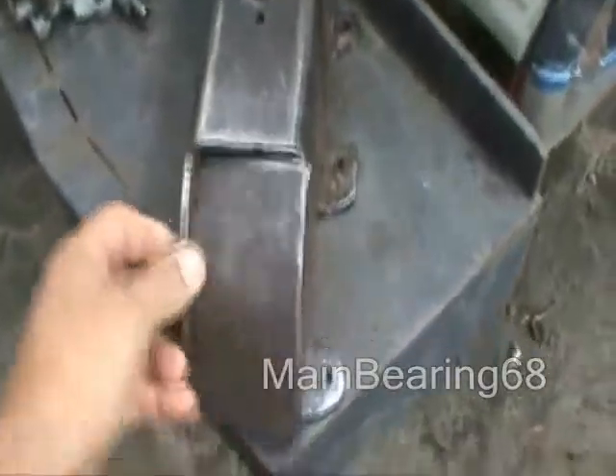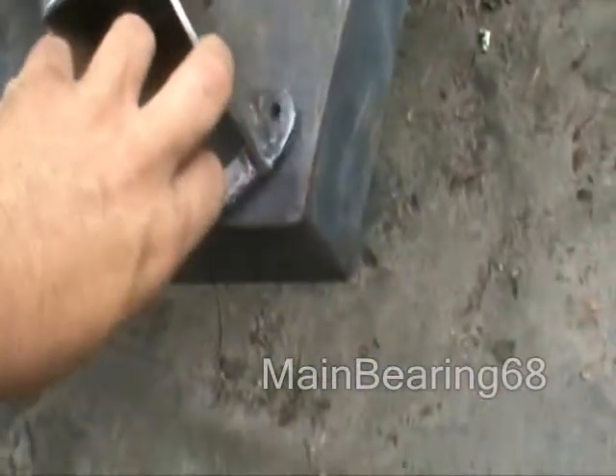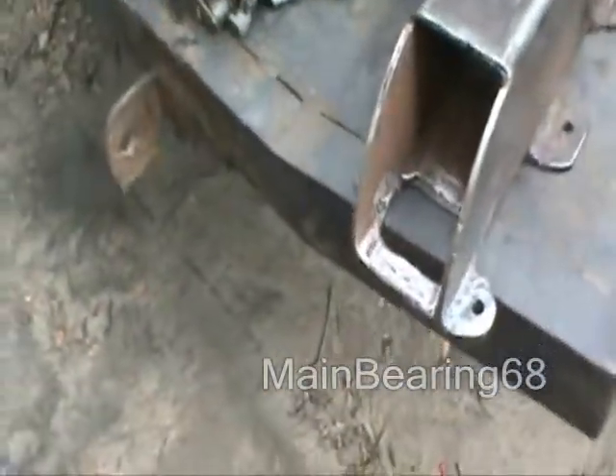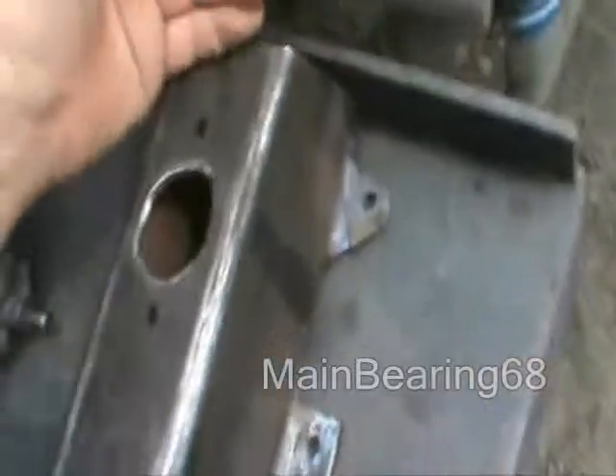We got some pictures of how this thing started. We're gonna weld this up, close this off here, weld that plate there, and we're gonna plug this hole in the back here. This big huge thing — the reason is the throttle body had nine square inches throat in it. For the volume of air, we decided on three by five, that's like 15 square inches for air. It could have been a little bit smaller but we used what we had — a piece of square tubing, cut it out of the square tubing, took some flat strap, laid it on top. I'll put some pictures here.